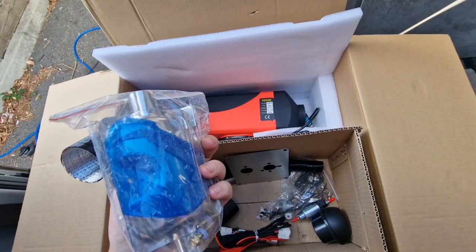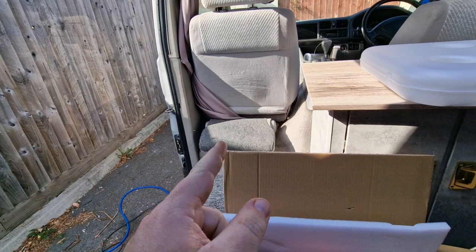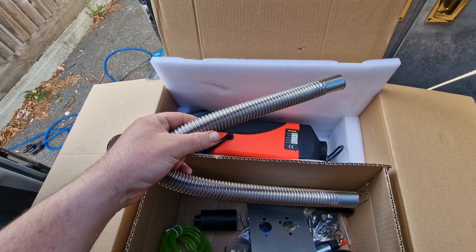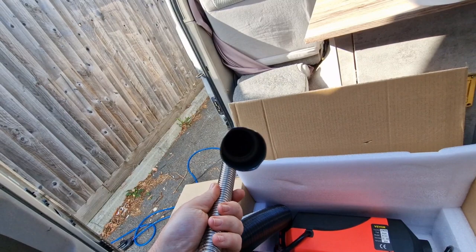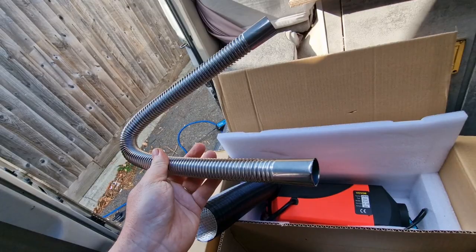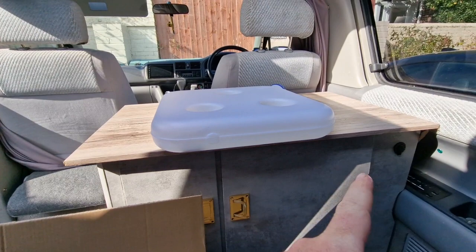There's the wiring harness - and the muffler exhaust silencer thing for the exhaust. Now obviously if the diesel heater is pulling air from underneath that area, you're going to want a longer exhaust as well - about two meters of the upgraded one. This one is just a bit of corrugated flexible metal tube. There's a better lagged insulated one available too. If you get a two-meter one you can run it across to the other side of the van so the exhaust goes out that side, keeping it away from the fresh air intake.